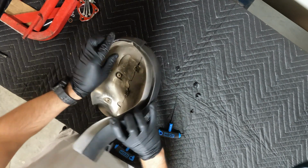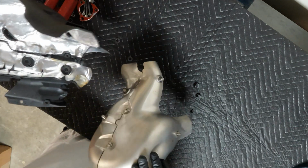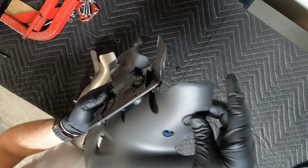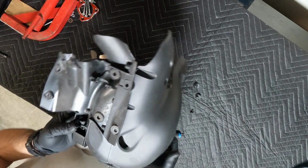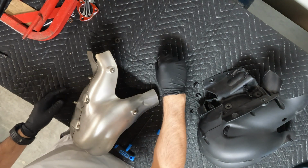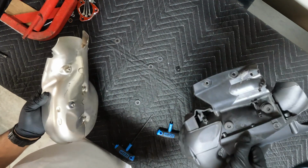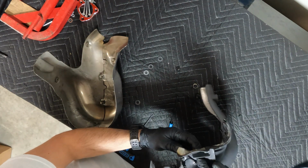They're just some dowel pins that hold it in place. With a little wiggling back and forth, you'll see these pins slide right out of the bushings here and here, and once again on top. I hope you guys can see this. I can't see what I'm filming with this new GoPro, so I'll have to see if I have to record all this later on. You're gonna have fiber washers on the underside of this bushing. I'll get one of these bushings pulled out and give you a little preview of what I'm referring to.